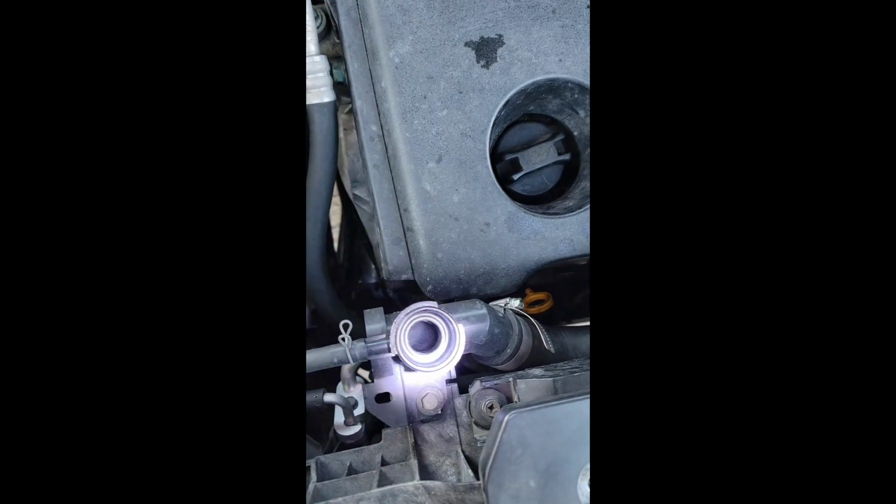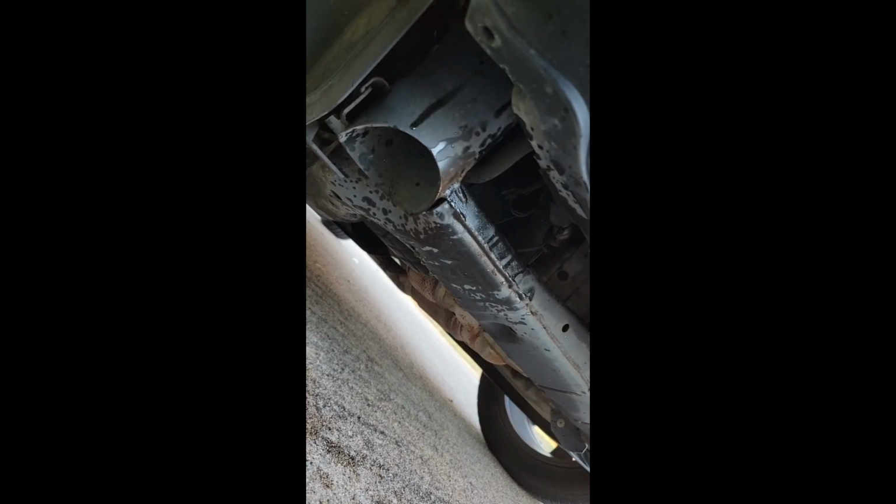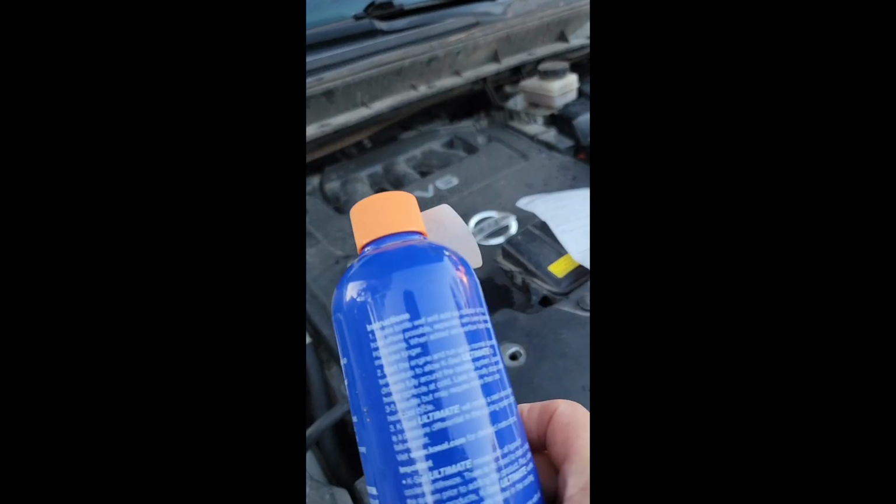So I'm trying to figure out how to drain some of this liquid. I found the drain valve of the radiator. I think I'm going to empty the system a little bit. I'm afraid that once I pop the valve, which is this X-looking plug, everything will come out. Just as I expected, once I started unscrewing the drain plug, everything came out and I couldn't stop it.